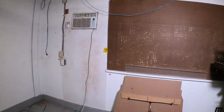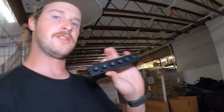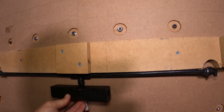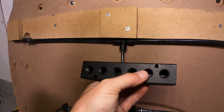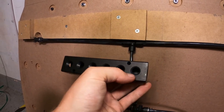I've got my nice little nook set up over here with this old AC unit — it's been going for about five minutes and it's 78 degrees in this part of the shop. I'm going to get going on the manifold. I got this off McMaster-Carr — it's 3/8 inch NPT in, quarter inch NPT out. I'm thinking I'll mount it so the compressors come in from the sides and out to the tanks. There are five tanks and six ports: five ports for tanks, one port for the water trap and then the manifold.